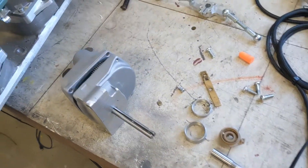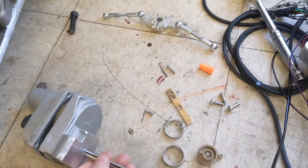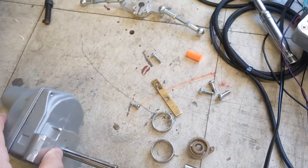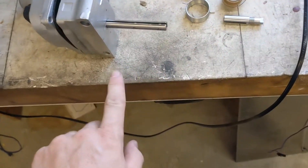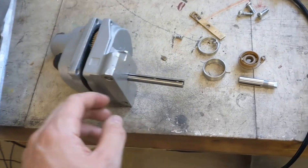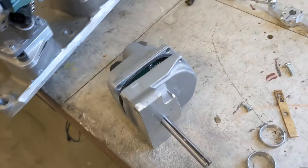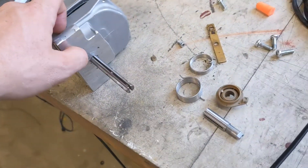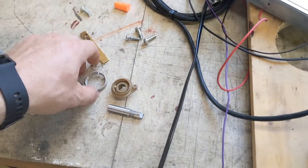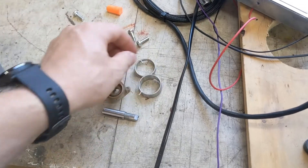I had a question about how my setup worked, so I'll just give you a quick run-through. This is originally an LS3 throttle body — there was a big throttle bore right here. As you can see, I cut it off and I machined it flat using a Harbor Freight router and a cheap router bit, so it wasn't super precise, but it works.